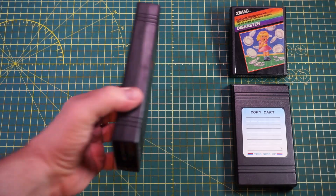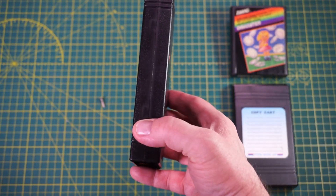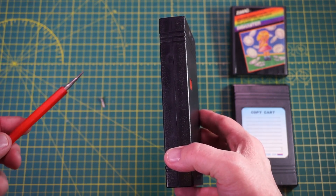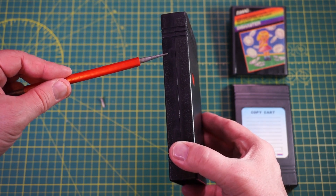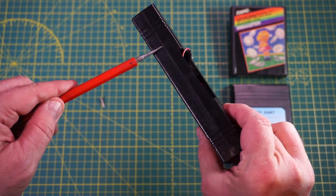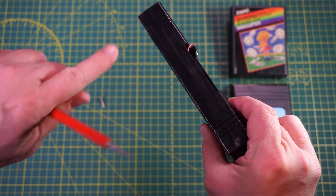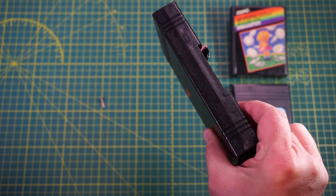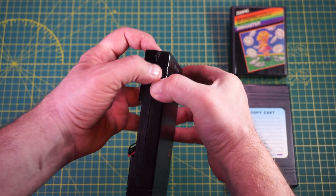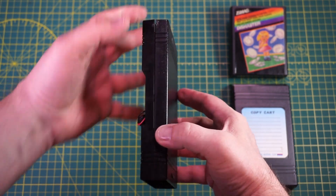Also like the copy cart, there are four plastic clips around the sides of this cart. But they are not under the ridges — instead, they are back a bit from them. Gentle pressure with your thumb and a little prying with your fingers will release the catches. You'll find one side is more pliable than the other when pressing. You want to press on the softer side.